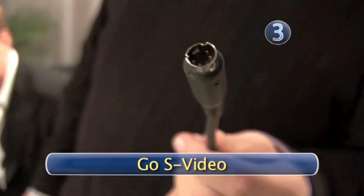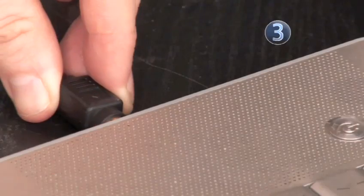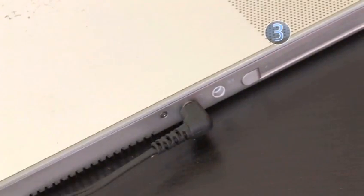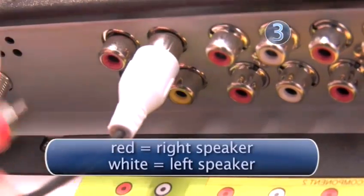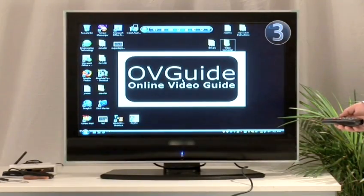But what if you don't have that fancy VGA cable? Step 3: Go S-Video. Instead of a VGA cable, you can also use an S-Video cable. S-Video is pretty simple — you connect one end to your television, the other end into your laptop. Okay, with S-Video we have video, but what's this for? That's the audio cable. Plug the mini end into your laptop and the red and white into the TV to get better sound than your tiny laptop speakers. And we just change the source or input to S-Video. And that's how you connect your laptop to your television.